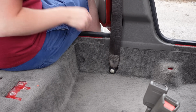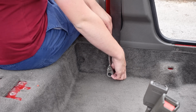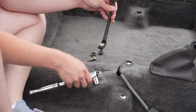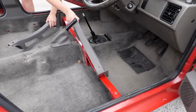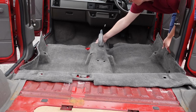Next to the seat belts. 3-door Metros of this age have the belt tied to a slider, which is then bolted to the floor, but the 5-doors, for clearance, simply have a bolt. Same with the buckles in the centre. Then finally, the trim covering the crossmember. The Metro's carpet is in 2 sections divided at the crossmember.